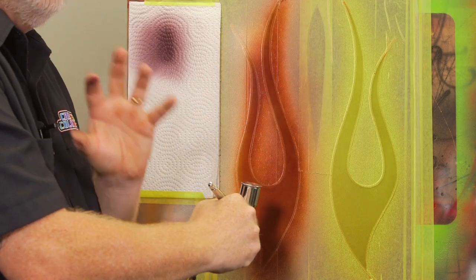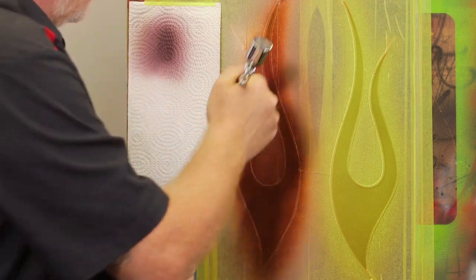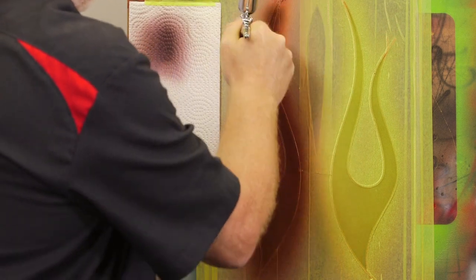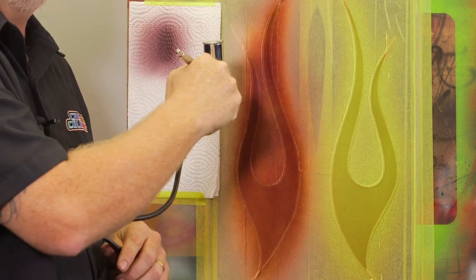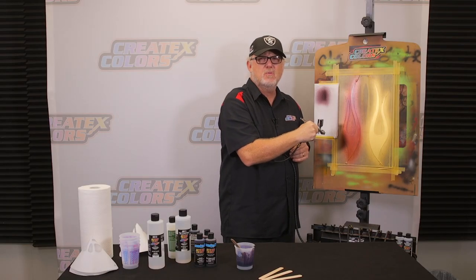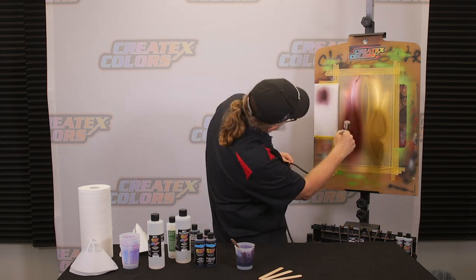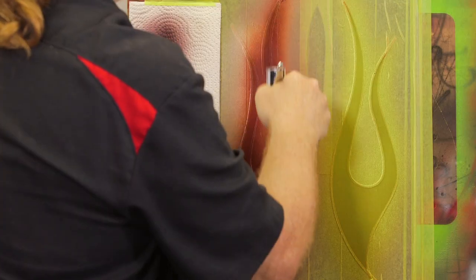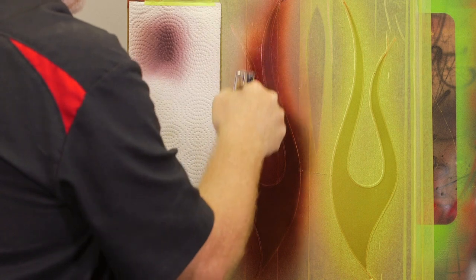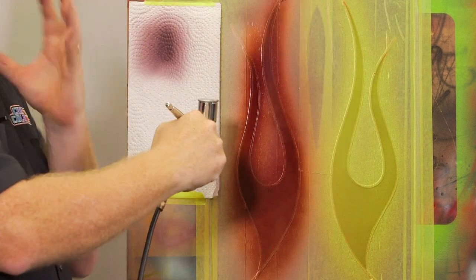If you've ever seen those candy apples that are black at the fair, those are actually red apples dipped in the candy red. So we're looking for something that's very, very dark. Black cherry is darker than the deepest candy apple red you'd ever have. When looking at this, the first thing you're going to say is, oh man, it's just too orangey and too dim. Layer it up and look at it, especially out in the sun, when this thing catches the sun, especially if you have it over flake or any other metallic. This is just a gold base done with Quicksilver gold. It's not going to be as sparkly, but when the sun hits it, it really glows.